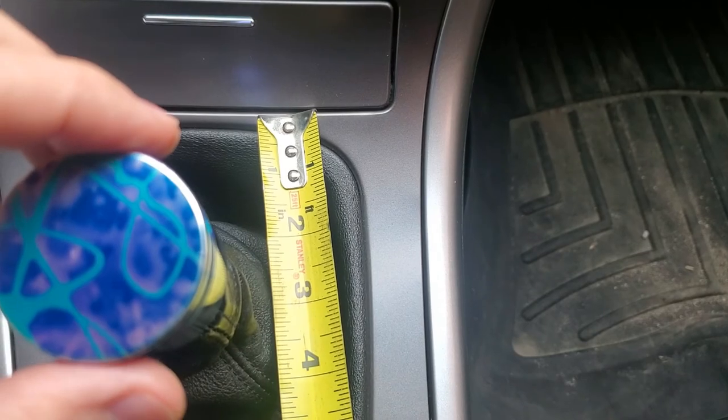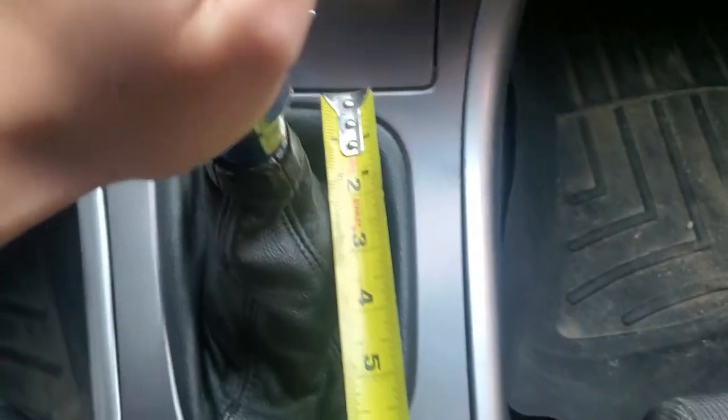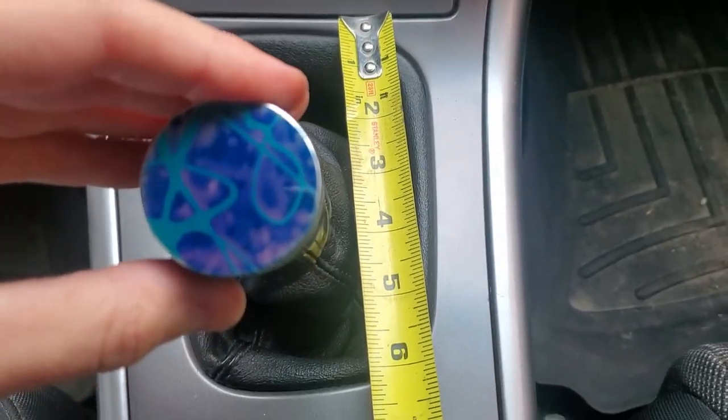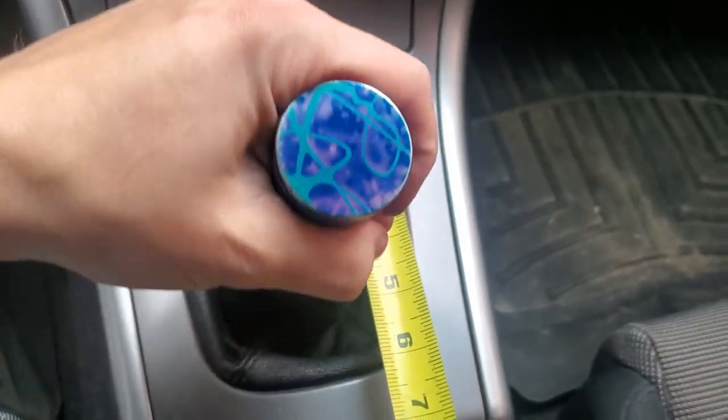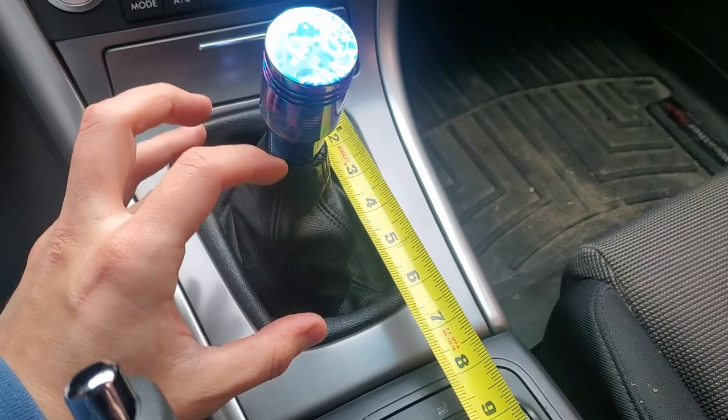I've been driving the car around for a couple of weeks now and I have to say the short shifter does feel a lot notchier — you just throw it in and out of gears, no problem. I really like it and think it's worth the install. It is the eBay one, which some people might question, but it was about 70 bucks with the bushings. I did not install the bushings because of the NVH — it's just loud and I don't want that for a daily. The throw went down about a quarter inch, which might be hard to see on camera with a different shift knob on, but it definitely feels better. Probably not the shortest shifter on the market, but for how cheap it was, it's definitely worth the price.